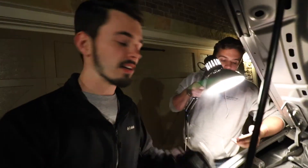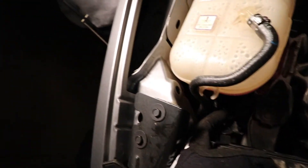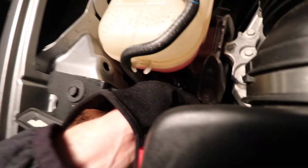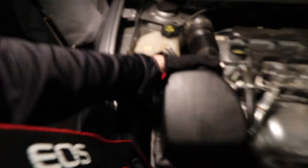All righty, guys. Air box is coming out. Now, there's something very tricky on this that I didn't check out until basically a minute ago. It was really hard to get that back piece out. Everything comes out — there's nothing actually that you have to get from underneath inside the wheel well. It's just that you have to pull it out, and there's this one little tricky spot right here. It's held on to this cable right here by some electrical tape. All you really want to do is get a pair of snips, snip the electrical tape. Be very careful, though, because there are wires right here that you don't want to snip. Just get the electrical tape and it should come right out.